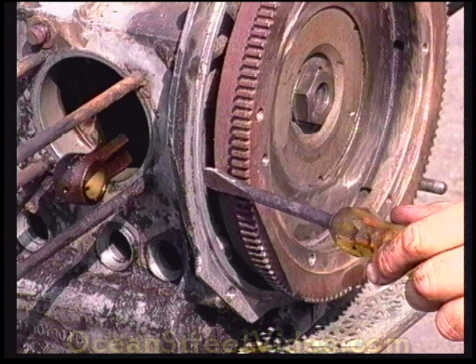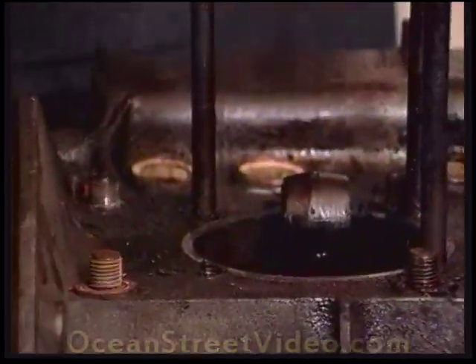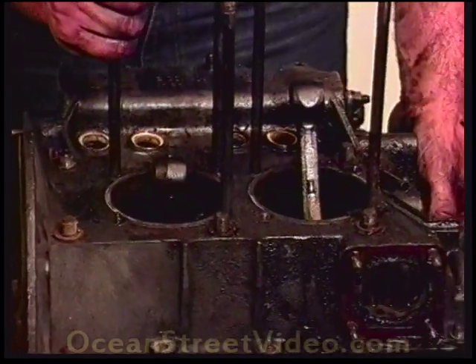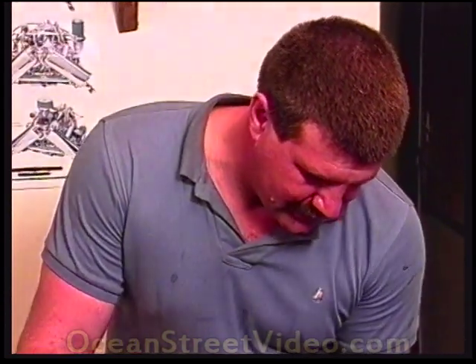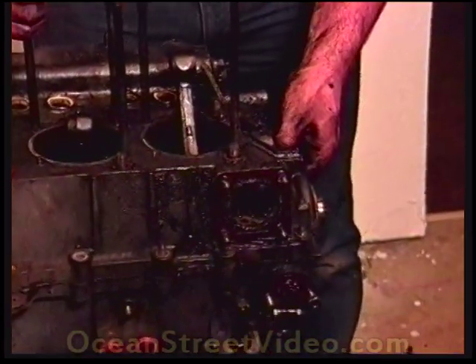After all the case nuts are off, you can pop the case apart with a screwdriver. This will have to be done with the flywheel on. However, you can break it free with an air impact wrench at the gas station. The best solution might be to take a long piece of angle iron and bolt it to the flywheel using the pressure plate holes. This will allow you to brace the engine when loosening or torquing down the gland nut. Remember, we still have the oil pump sitting in the front — there's a reason I left it in there because it's very tight. There's a special oil pump tool we can use, which I recommend getting, but once you start loosening the case halves you can actually lift the oil pump out easily.